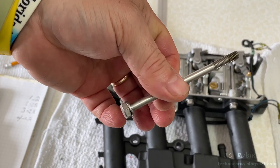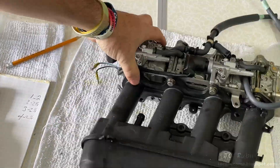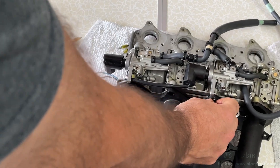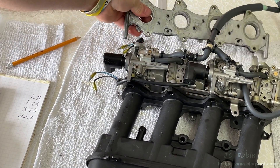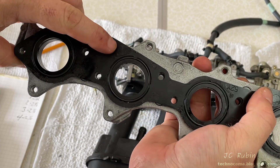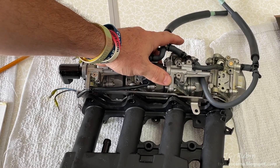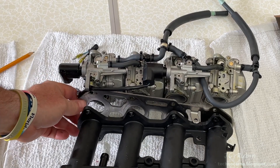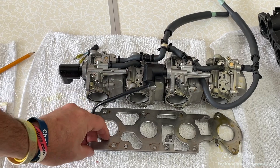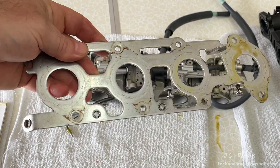With the tension released, I'll remove each bolt one at a time — it also has a washer that goes inside the plastic. I'll remove those two, then flip it over to do the other side. Once the last one is removed, everything just falls apart. There's the back plate — we can see it's dirty on one side and held together with two plastic rivets and four O-rings. We'll clean it and deal with it later. Now we pull the air box away from the carbs — there's also a plate in between — and we can see four O-rings on the air box.